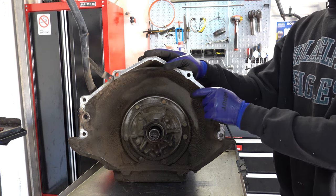So, in a factory application, if you're going to run a stock width band, I could probably reuse this drum. The only thing I would do is take maybe 600, then 800 grit sandpaper and just go over the surface with one sheet multiple times just to get it deglazed so that the band bites and holds just a little bit better. But for performance,